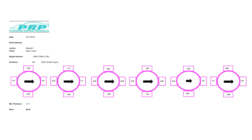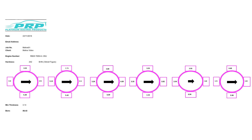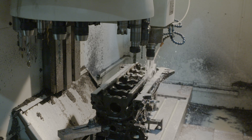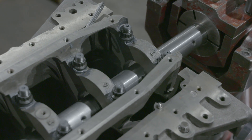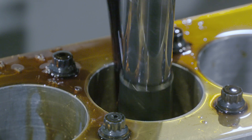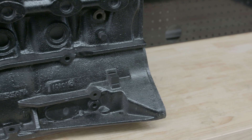It came back with all bores over 3.1mm thickness with its 86.5mm bore and a hardness of 242, which is average for an 05U. Basically, our block wasn't bad, but it wasn't above average in any way. Next step was to have the block machined for a Platinum Brace to help improve the strength of the factory block. It was then off to Duncan Foster to have the machine work done. The block was line bored and honed as it has ARP main studs going in, which when tightened up can distort the bearing cap slightly compared to factory. This block had previously been torque plate bored and honed, so it was only getting a light hone ready for another set of 86.5mm pistons. And lastly, it was decked and cleaned ready for assembly by the guys at Croydon Racing Developments.